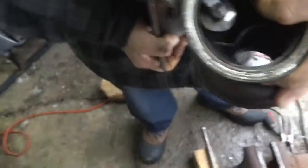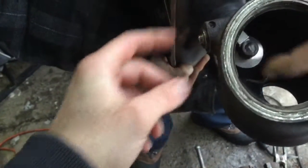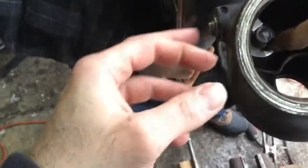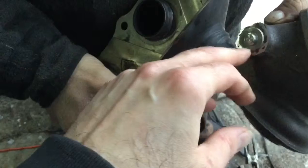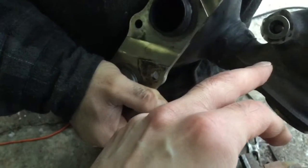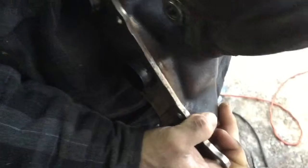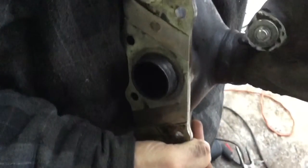Okay, you have to try the wastegate. Make sure that its swing is free in the bushing. If it doesn't swing free, you have to check. Maybe with the hammer you punch it a bit toward the inside. Then you take a round file and just smoothly you make it good. This one was a bit of a problem. The other one was fine. We also filed down just a little of the shaft. There was some kind of a burr on it, so that's what we did.